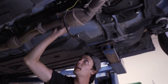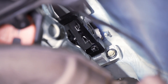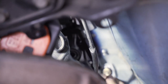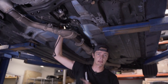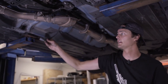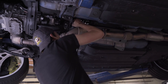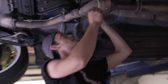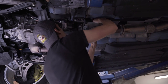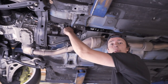Now install the reverse cable. Feed it up to the bottom of the assembly and insert this whole section right up into it. Push it back a little to make it easier to feed up, go in on the right side of the joint — slide it up in there and give it a nice snug. Now reassemble the heat shield and reconnect the O2 sensor into its harness. Feed the harness back through the heat shield and connect it.